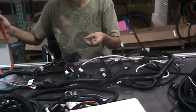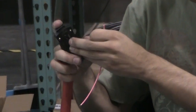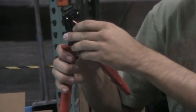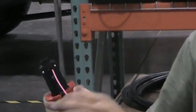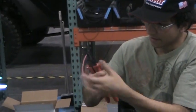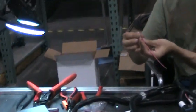If you want to use the male tool with an M on it, you open it up and insert the connector in. We're going to use 20 gauge. Push this tool down right here, insert the wire inside until it hits the stopping point, then pump it up.